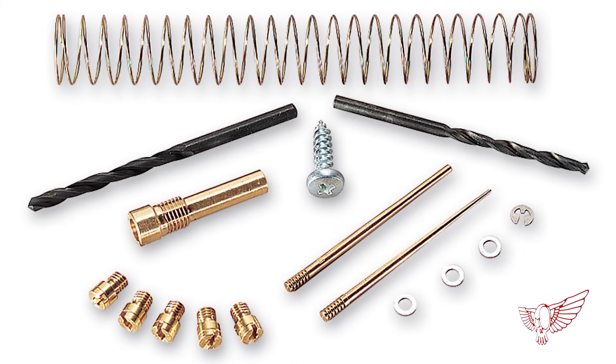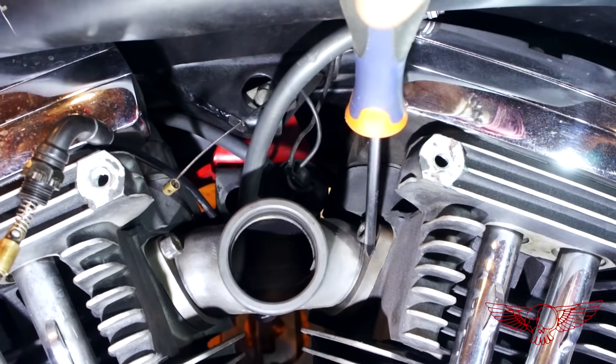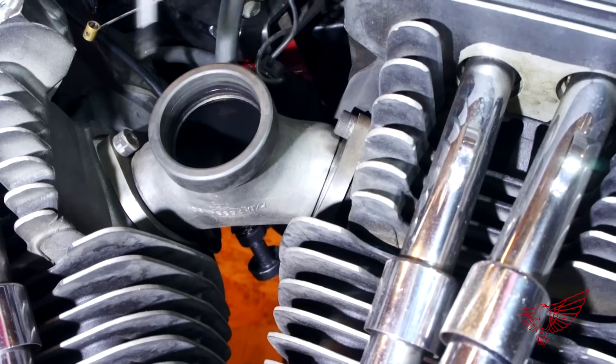You should know that if after three turns counter-clockwise the RPM on your bike keeps rising, it means the jet is probably too small and needs to be replaced with a bigger one. On the other hand, if your adjustment sounds just right with less than one full turn of the screw, probably the jet is too big. It takes a bit of patience to find the correct setting, but it's totally worth it. If you find that you cannot get the mixture adjusted properly, verify that all gaskets are placed correctly and the connections are airtight — for example, check between the manifold and the two cylinder heads, or between the manifold and the carburetor. An air leak in any of these points would lean the mixture, de facto compromising any adjustment, jet size, and so on.